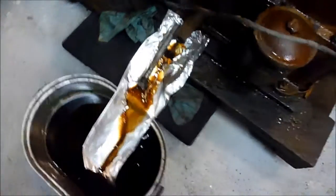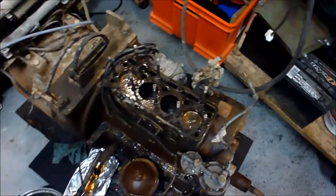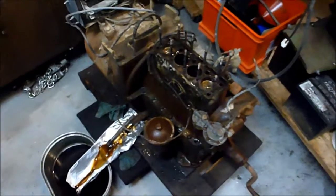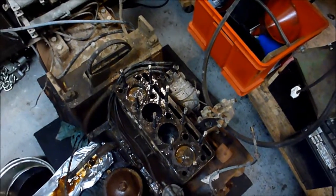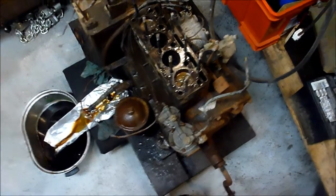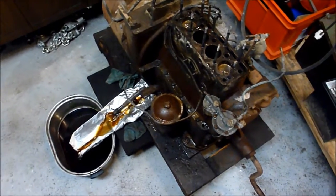I went ahead and drained the water out — there wasn't as much as I thought, which is good. Then I sprayed everything in the head down with WD-40. Since I'm planning on taking the access cover off down there, I don't think it's that big of a deal as long as I stop any rust. I sprayed WD-40 over everything including the pistons and cylinders, then rotated the engine. You can see some rust that came off the cylinder walls — that was from where I'd been vacuuming and using brake cleaner, which wiped all the oil off and they were already starting to rust. My mistake, but I think it's easily recoverable.